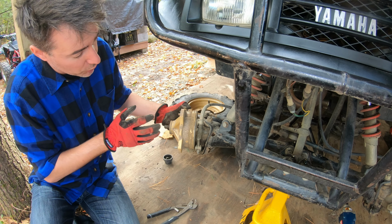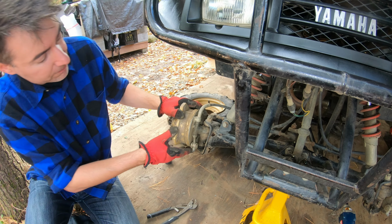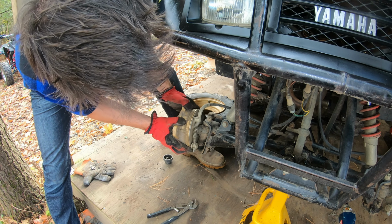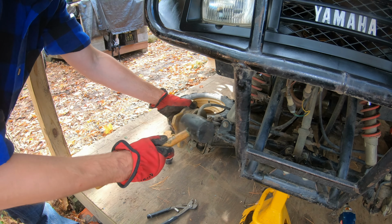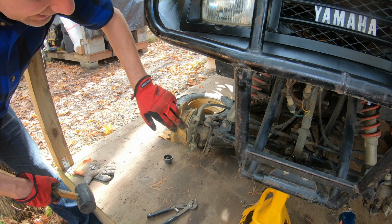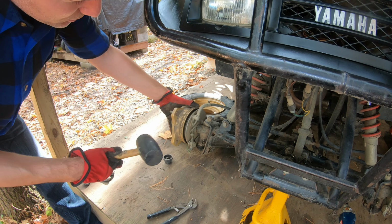One of the risk points is if you go too long, the pads wear down, starts to wear into the hub, and then you have to replace the whole piece. You can feel that on the, I don't know if you can hear that, but even the bearings are a little wackadoodle on this one. I'm gonna get a persuader. Okay, it's coming. It's always tough. If you try to get in here with a flat head to kind of pry this off, this is really die cast and you start chipping off the hub. You also don't want to smash too hard on the actual ears here, the lobes. Glad I'm doing these.